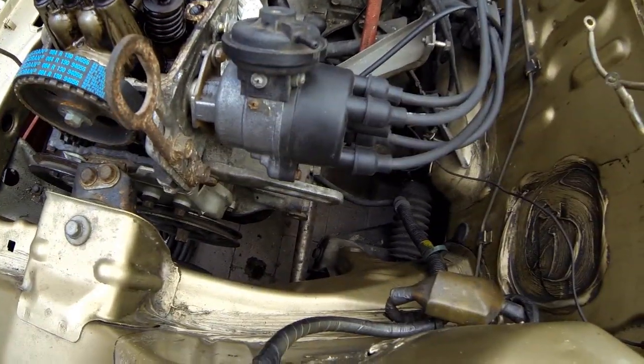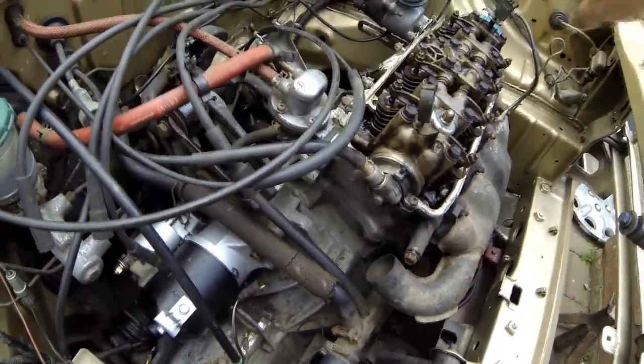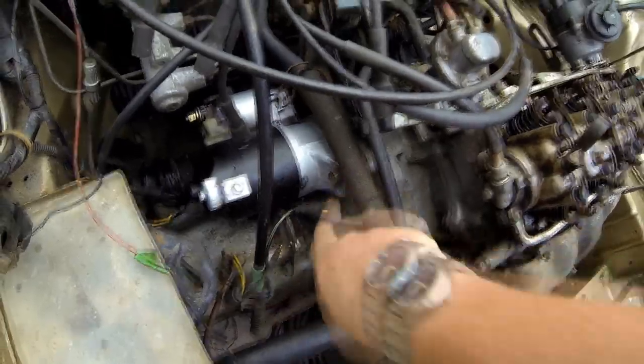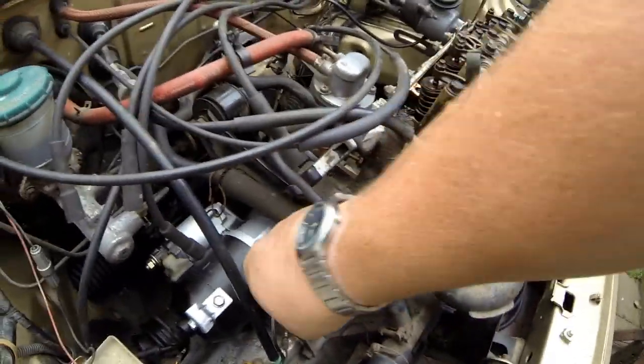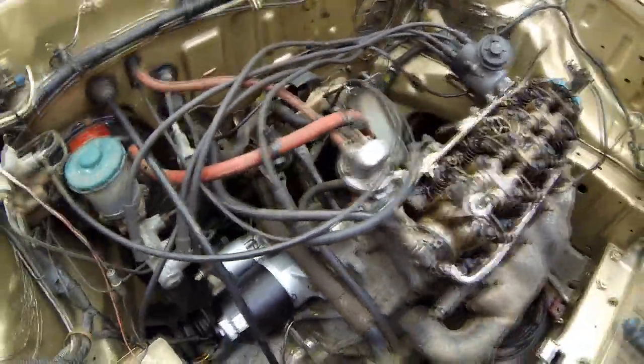I've repainted the radiator and that's got to go back in. There was also a plate down here that was all rusted which has got to go back in. Now, if you can't undo your nut on your lower pulley, here's the starter motor — all it is is a matter of undoing two bolts to get it out. One goes in this way and the other is on the other side. The longer bolt and the shorter bolt — make sure they go back in the same way. Then your starter motor comes out and in there you can get a large screwdriver, see the teeth on the starter gear, wedge that, then get a breaker bar and undo the nut anti-clockwise. That's if you haven't got an air gun.